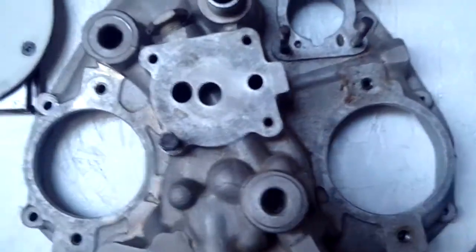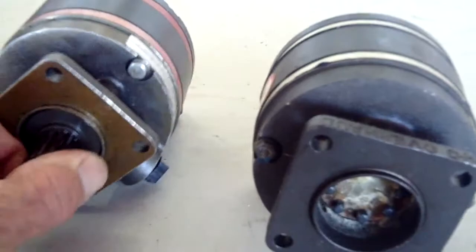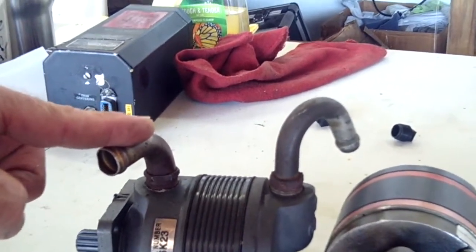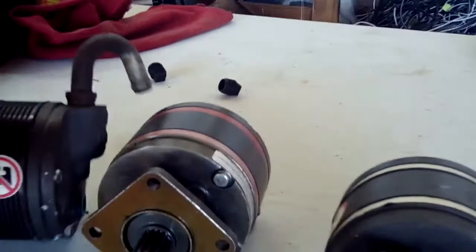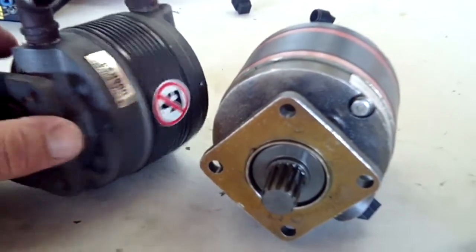So that's a real quick story of vacuum pumps. Keep in mind that you have two fittings on your vacuum pump: you have an intake fitting which pulls air through your instruments to spin them up, and this is your outlet port. There's a short piece of rubber tubing or clear tubing on it — it just keeps the pump, if it should run backwards a little bit, from sucking any debris into the pump, which can cause premature failure.